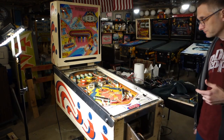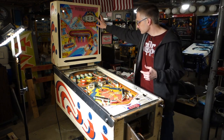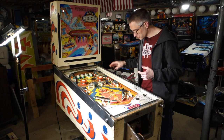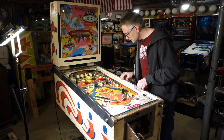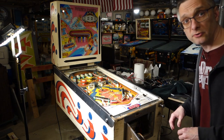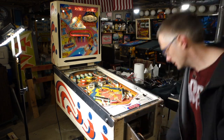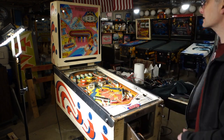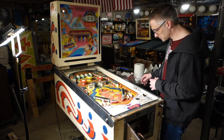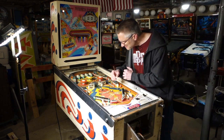All right. But we got 1 point on the display, so that's a little unusual. There must be a 1 point switch that's activating somewhere. One thing at a time. Okay, so we'll power it on again. At the left flipper. And we'll shut it off, because we got something. It's a 1 point switch that's being held here. So, gotta figure that out.